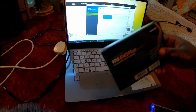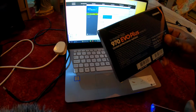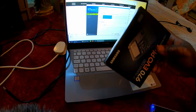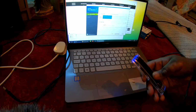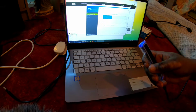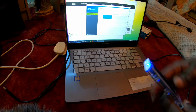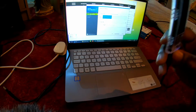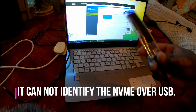We're going to be using this one today, which is a 970 EVO Plus, but 500 gig. I had the 1TB out anyway because I was formatting it and seeing if it actually worked, and then I came across this: Samsung data migration does not work from caddies. Not with the M.2s. It works from caddies for conventional hard drives with their SSDs, but not an M.2.